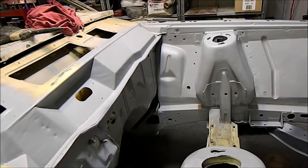Probably a bit of a waste of primer, but I wanted to get it all in one colour because it's easier to see imperfections. There are some there for fill — I sort of knew they were there. It doesn't have to be perfect because they never were — they were quite wavy when new. I've put it in a bit of primer, a bit of etch, then a bit of high-build, so I can rub it back and fill little bits. Mainly it's to seal off the bare metal. I've still got to do around this side — I need to put the battery tray in and weld a bit there.